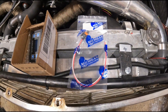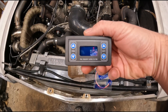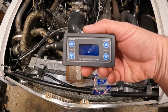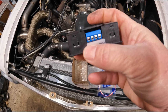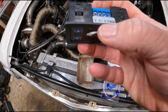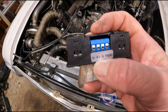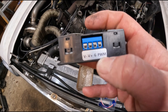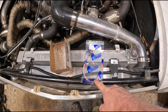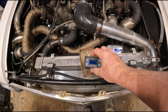So there's the alternator plug, and this is the little PWM signal generator — it lets you set the frequency and duty cycle, which is all we need. It's got the wiring right here where you plug it in. From what I know right now, the V-plus needs a five-volt signal from the ECU, which the MegaSquirt has some five-volt outputs I can splice into. The ground will just be signal ground, and the pulse-width modulator output goes to the L terminal on the alternator.